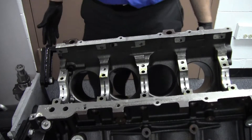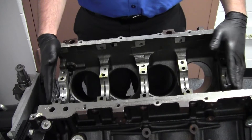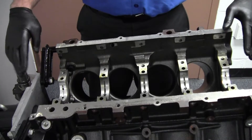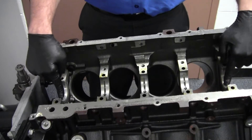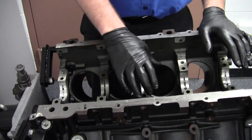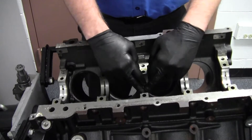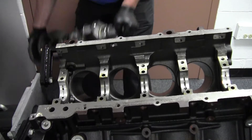In this video I'm going to demonstrate how to measure crankshaft runout. I can do this using the block — you can do it using V-blocks, but for this demonstration I'm going to do it in the block because I don't have V-blocks big enough to fit this crank. I've taken all of the main bearings out of the block except for the front and the rear, so that if this crankshaft has any runout — meaning it'll wobble up and down in the middle — the lack of these bearings will allow it to wobble.